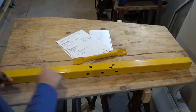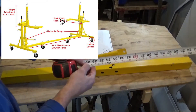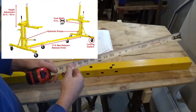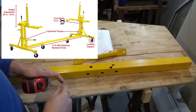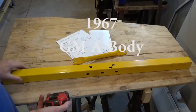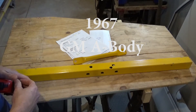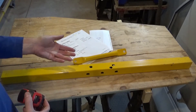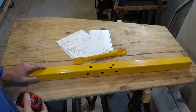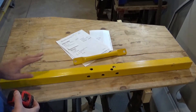These components here — it wasn't that clear on the website — are 39 inches long. Depending on the car you're doing, that might be good, might not be. I am restoring a '67 El Camino, which is a Chevelle-type car. It's a Chevelle body only with a bed in the back. I need one that's 44 to 45 inches. So if you're doing a Chevelle or an El Camino, these are not going to be long enough. So I had to make some.